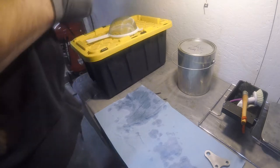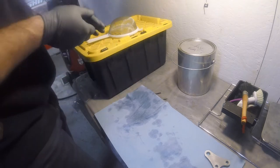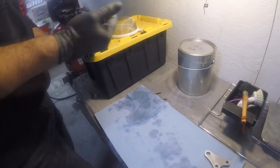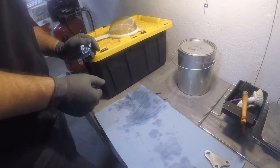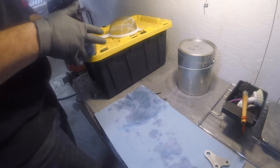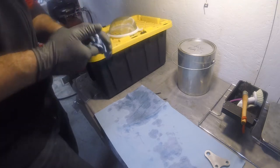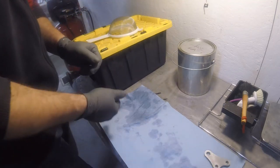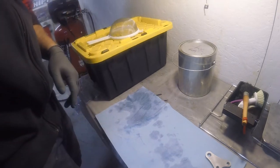That's what I'm working on, getting a big slop sink, that way I can fit swing arms and subframes in there. And you can hit it with Bright Clean and then wipe down really, really well. And just do the gas out. The gas out is really important, and that's how you tell if the Bright Clean and everything did its job. So we'll go get the mask, open this up, throw these in there, and then we're gonna do gas out after that, after 30 minutes.